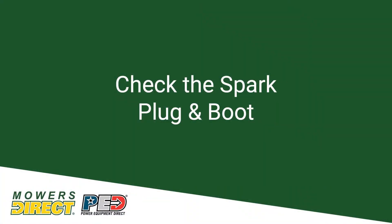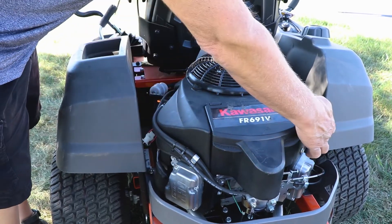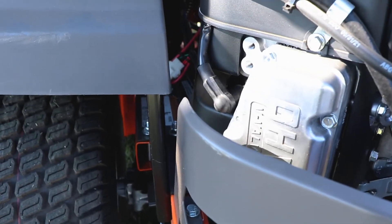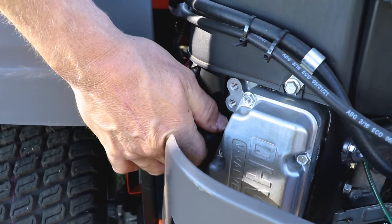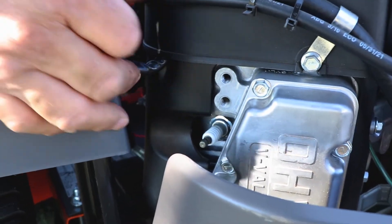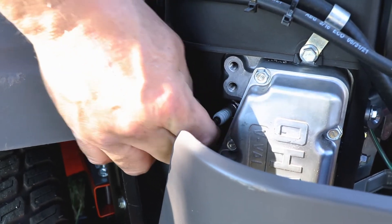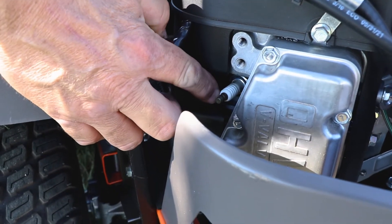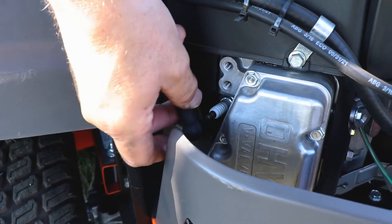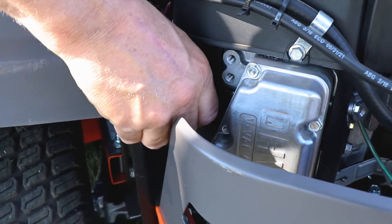This motor, being a twin cylinder, has two cylinders — one here and one here — with two spark plugs, one here and one here. Make sure that the spark plug wire didn't get disconnected. This is your spark plug boot; it transmits the spark from the coil to the spark plug. If you unplug the boot, there's your spark plug. You would need a socket wrench to take the spark plug out to change it or clean it. Once you put it back in, hand tighten it. Be very careful if this is porcelain that you don't break it — you don't want to put too much tension on it, just get it up really snug. Once that's snug, push the cap back on and make sure that you hear it click, which means it's on completely.